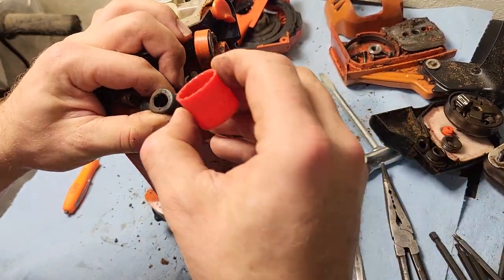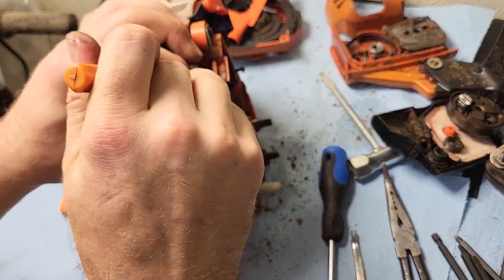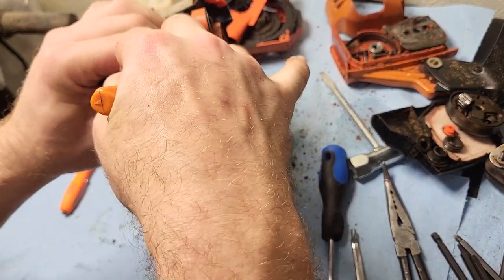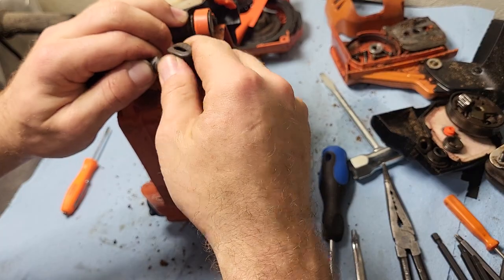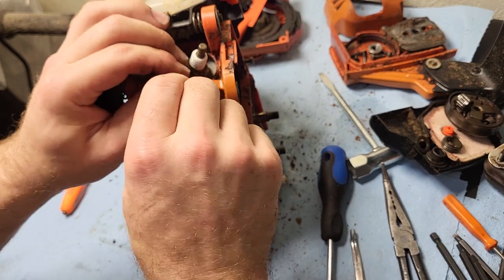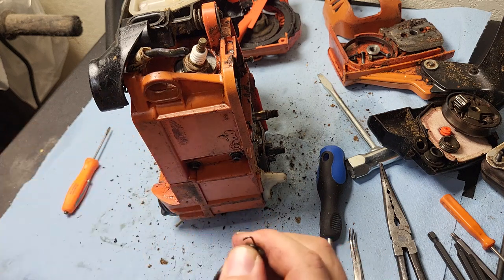I think I'm going to have to put a drop of oil in this end. Poke around in there — you don't want to tear it. If you tear it, you for sure are going to need a new one. A little lubrication on that spring that retains the boot — now it's wanting to rotate. The plug wire stays in place, the boot wobbles around, and it pulled right off. Keep your spring with the boot — stick it in there so you don't lose it. Fish the wire through like we originally planned.